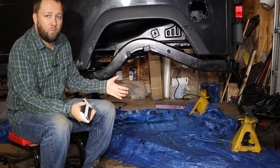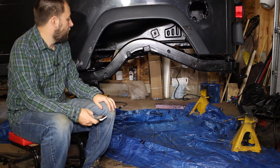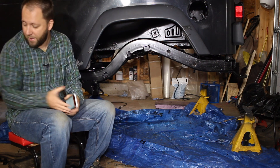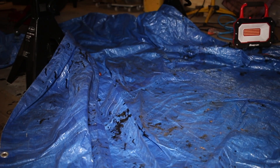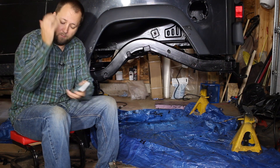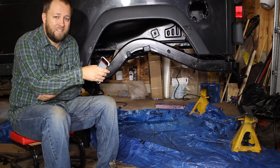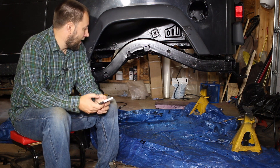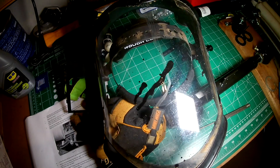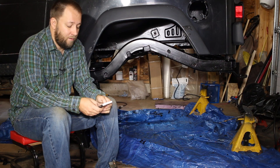I would recommend top coating fairly quickly — it all depends on your weather and humidity, so I can't give you an actual timeframe. You have to go by touch and feel. This stuff got everywhere — my pants are destroyed, just covered in paint. You can see the tarp took a beating, but the good thing is I really didn't get any on me. I have a little bit on my elbow where there must have been a hole in my shirt. Five days later I can tell that's not coming off anytime soon. Taping your gloves and wearing a full mask — I definitely recommend that. My mask took a huge beating and I'm so glad I was wearing it.